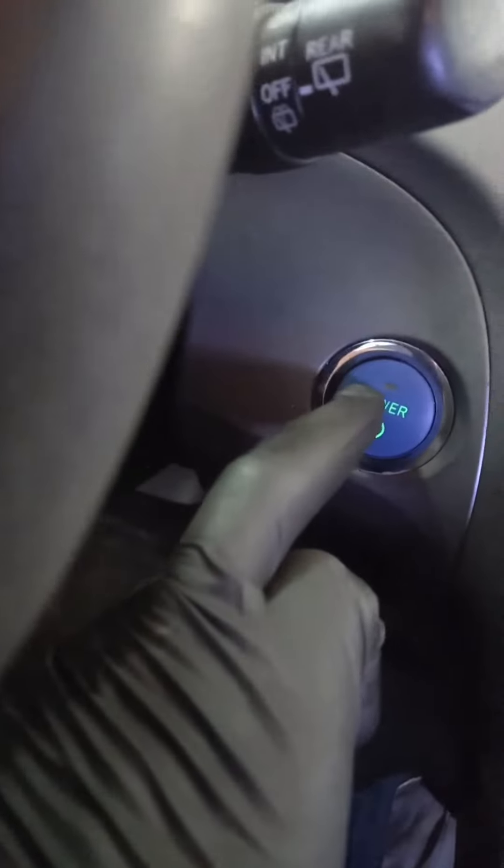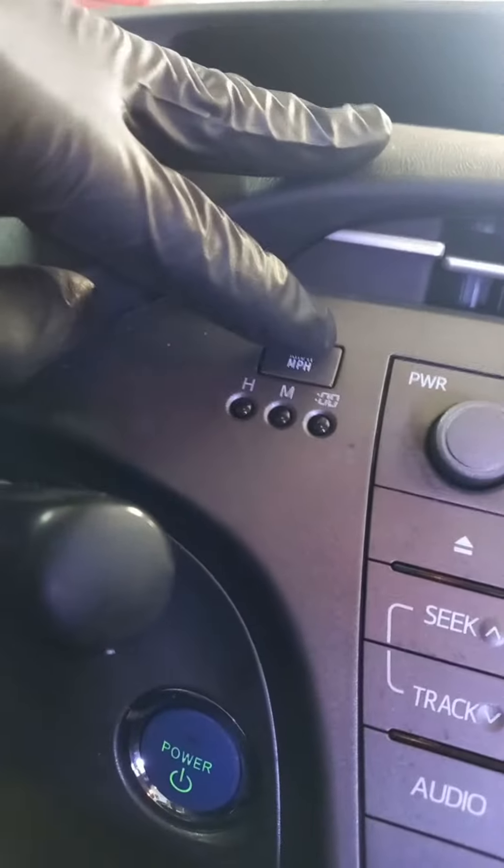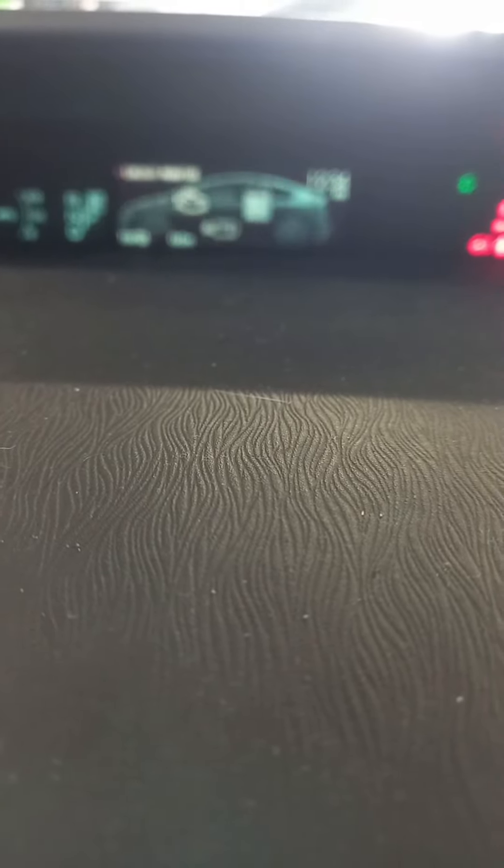While it's on Trip A, you're gonna shut the ignition off. You're gonna press this button right here and hold it, and after that you're gonna press this button to turn on the ignition. Once you turn it on, you're gonna see the maintenance required light moving until the reset is complete. When you see 'complete reset,' everything is done.